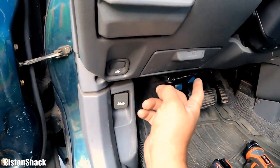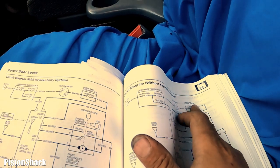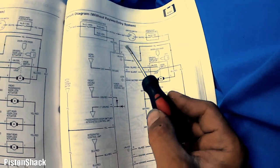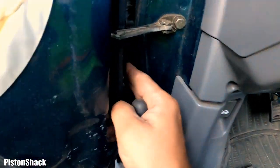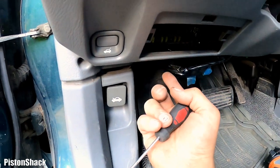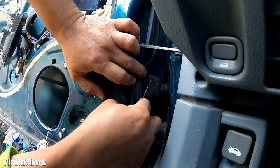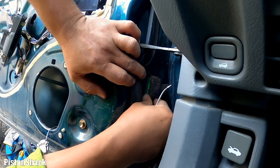And that wiring harness is coming inside and going up to this connector. We know we have power at the fuse over here. So somewhere from the fuse, we have an open somewhere in this wire. Probably where is that door? Well, let's try to get to that connector. I don't worry, directly under the dash, it's probably somewhere here in that connector. Okay, let's try to remove this weather boot and get access to the connector itself. Let's see what we have here.